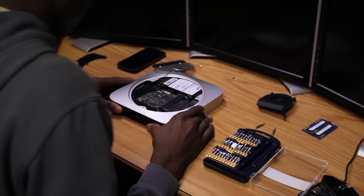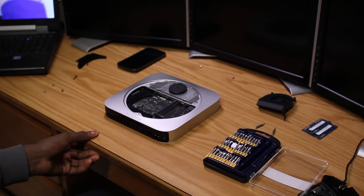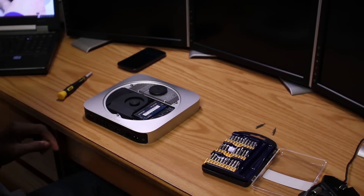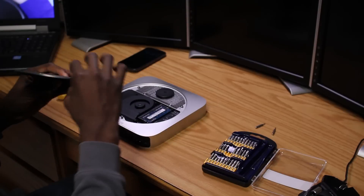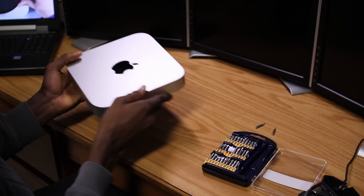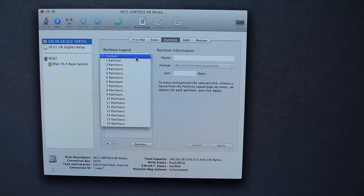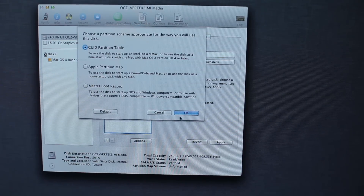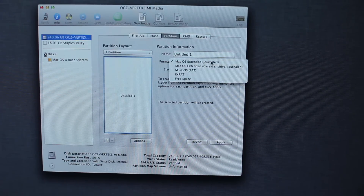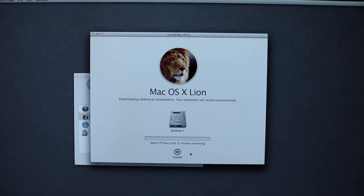It was altogether pretty painless. I've never opened up a Mac mini before, so stuff was much more crammed together than I'm used to when I build regular tower computers. And I do have massive, gigantic hands, so that was probably the most difficult part. Sure enough, 25 minutes after I started I was done and it was time to fire up the new Mac mini for the first time. When you turn it back on, hold down the option key and you'll get the disk utility where you can format the new SSD in one partition for OS X and begin a fresh install of Lion — which took about 20 to 25 minutes. And that is where part 2 finishes.